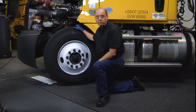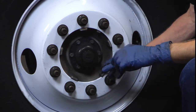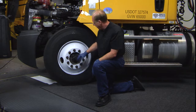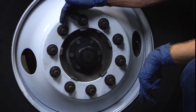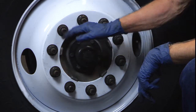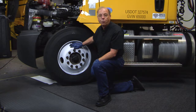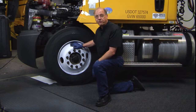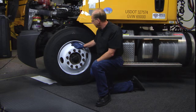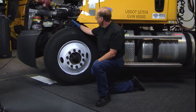We're looking at the hub assembly on this vehicle. You'll notice a standout here that helps center the wheel to the hub. We also have 10 studs on this one. While you're inspecting, you should be looking at the threads to make sure they're okay. Everything looks fairly new on this truck. It has a white wheel, and we say you should always at least hit it with primer to make sure it looks good.